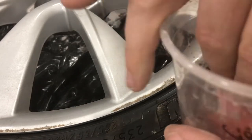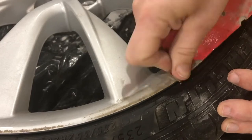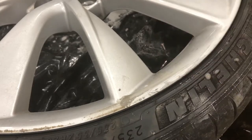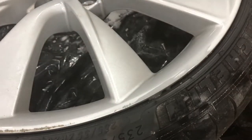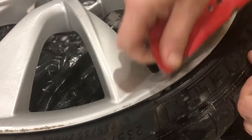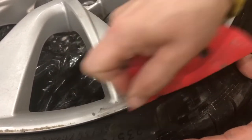Let's start with the less deep curb rash repair. I'm going to use 150 grit sandpaper, a little bit of water just to help the paper last, and a little bit of elbow grease. That's all it's going to take — it only went through the metal in a few small spots, and I'm going to sand deep enough to get rid of all of that. Just scrub away and the curb rash disappears. You are ruining the paint when you're doing this, so you could do a small touch up. In my case I wanted to paint the entire rim so they'd match perfectly. If anybody is just planning on doing a touch up, there is something available that works pretty well — just send me a comment below and I'll answer.